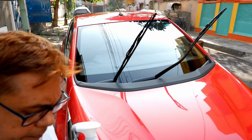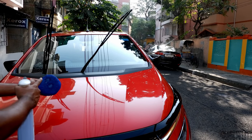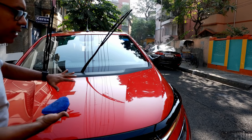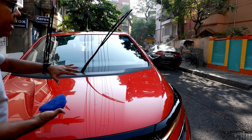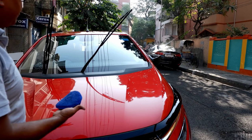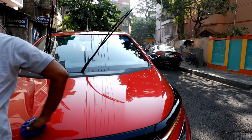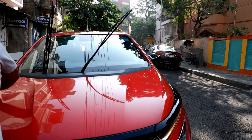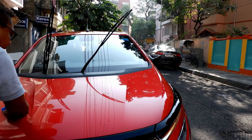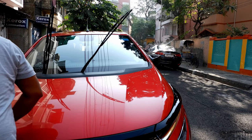Now the application. Three sprays — I will spray it on the car. Remember, you should always do this particular job in a shade or in a shaded area. Do not apply it under direct sunlight. This is the perfect weather condition to do this particular job. Do not over spray — otherwise it will lead to formation of streaks. I have got a lot of feedback from my subscribers who have over-sprayed their products and that has led to formation of streaks.